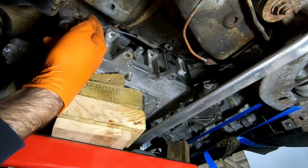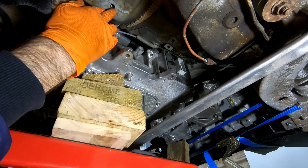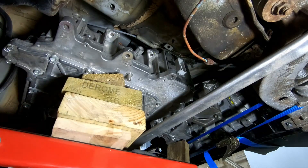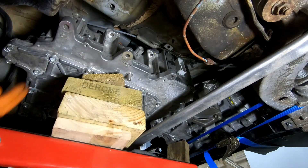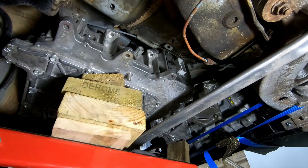There's also back this way up just here — there's where part of the transmission mount used to go. So I'll run something down under and back up the other side, and then we can tie it into some of these stock mounting points on the inverter. Then we'll plate under this so the normal Porsche underbody stuff goes to about here, and we'll just extend that to here and then probably to the front or back support for the motor as well, just to assist with aerodynamics because we've created big gaps where we didn't have them before.